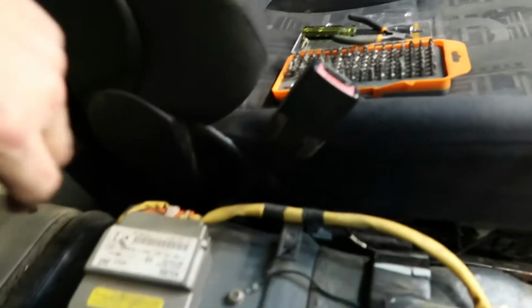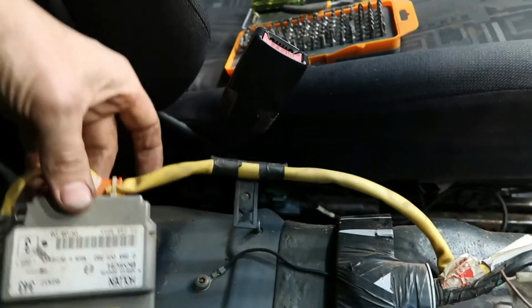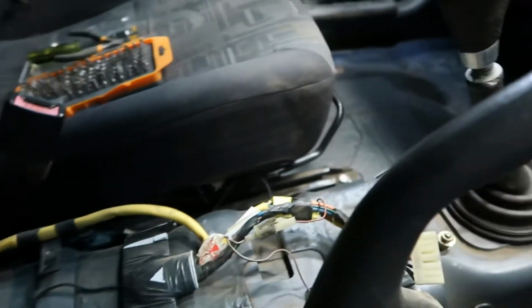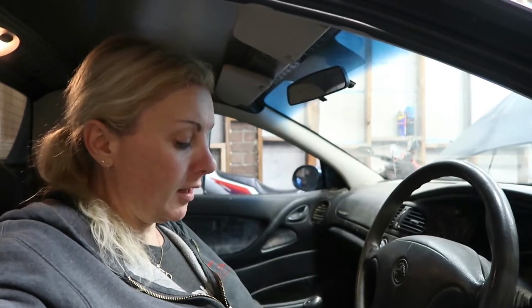Right now, actually, I've disconnected the battery. I'm going to pull out the airbag sensors and airbags because no airbag in a race car. Not in this car, anyway. So I've just removed the airbag out of the steering wheel. I don't have a different wheel at this time, so all I did was pull the airbag component out of the wheel. Yes, there's an explosive in there. Yes, I'll have to take it to a proper disposal facility. Now I just have to tackle some of this wiring.